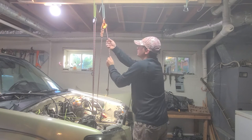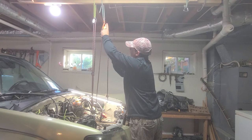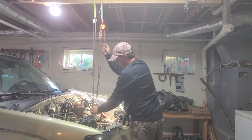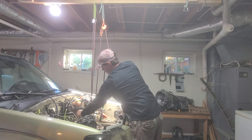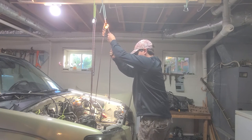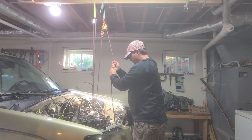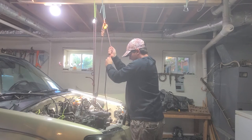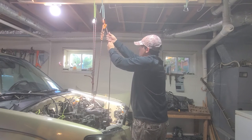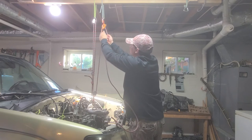So to get started, when we pull up, the hitch is going to tend itself. This pulley is going to tend the hitch, so it'll look like this. Ease it up to start. And since this is an overhead application, whatever you're pulling from, whatever your anchor is up top, needs to be extremely strong, plenty capable of holding the weight.